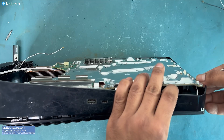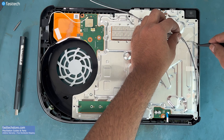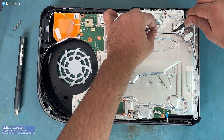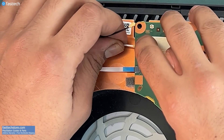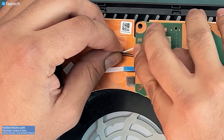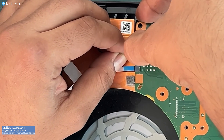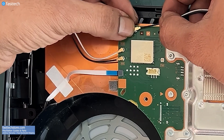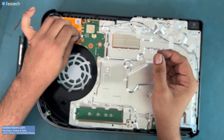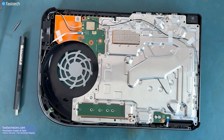The motherboard and heat sink assembly is ready to be installed in the case. The antenna wires go through here. We're going to put the antenna wires under these tapes. Next we're going to install the antenna connectors by lining them up and pushing down until you hear an audible click. Now we're going to install this ribbon cable all the way to the blue line, and same with this one.